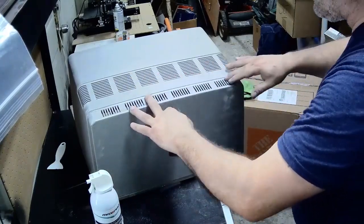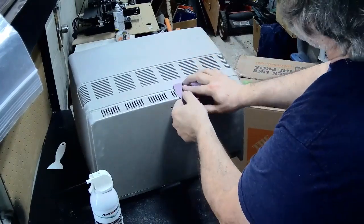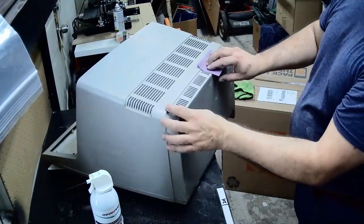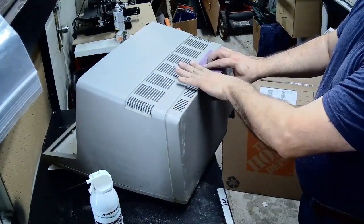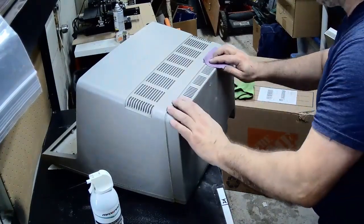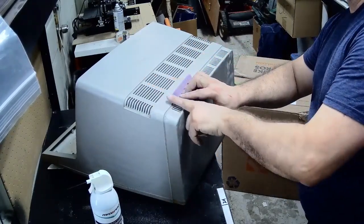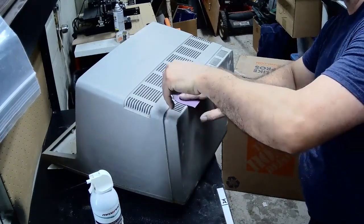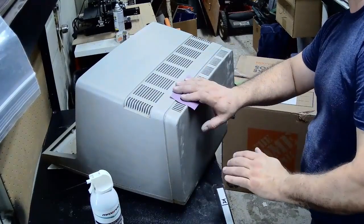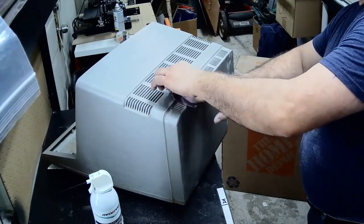Now when you get these edges here, what you want to do is put your finger on the ridge. I'm not folding it, I'm laying it across the ridge, but I'm using my two fingers to press down. You see, it lifts. The only point of pressure I have is at the tip of my fingers and at the flat. So when I do this, I'm actually doing the groove without damaging or flattening it. I'm not trying to cut this angle here because it comes sharp and then it's a half moon drop. I want to keep that because that's part of the case. If I go like this, now I'm sanding the angle here, and that changes the plastic very quickly because it's a sharp angle.